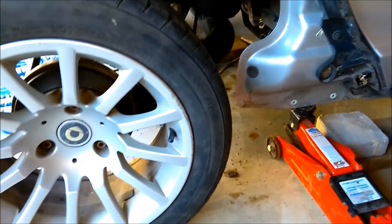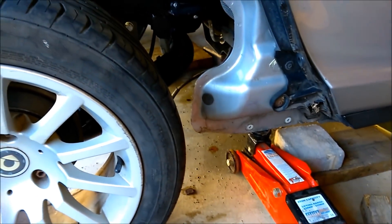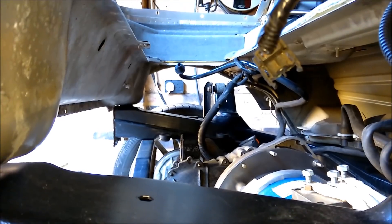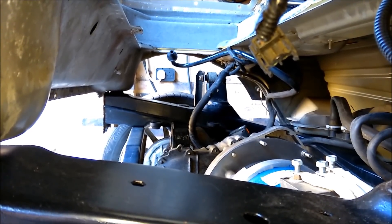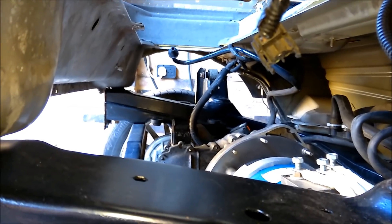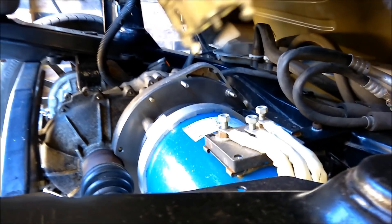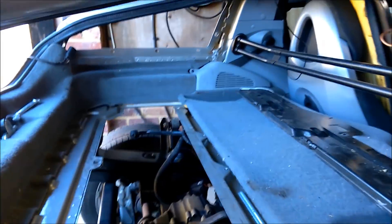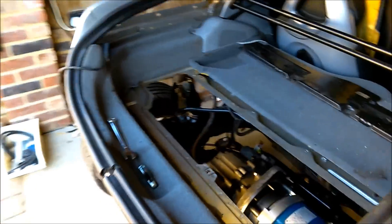Just lowering that down on the jack - it's on the chassis now. There's plenty of space for all the tubes and quite a lot of space in between the chassis and the underside of the boot, so that's where the controller and batteries will sit. We just need to make an aluminium box container for them all and then sort out the plugs. There really aren't many other connections apart from the three connections to the motor and the encoder on the back of the motor that need to go up. So there we have it - it's a rolling chassis again and I can start to build it all in properly now.